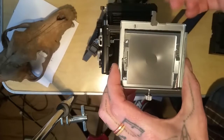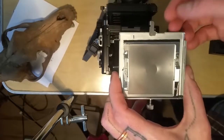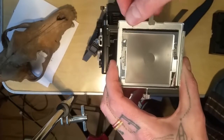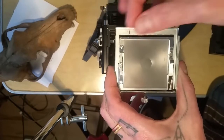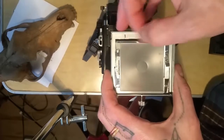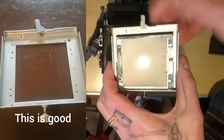When you're removing the old light seals, take an exacto blade — and if you want, a little bit of rubbing alcohol; I use 91% but I think anything less would work fine — and just very gently scrape away the old glue and any of the old material. Q-tips come in handy in this process because you can wipe away as you go, and a little paper towel to wipe off the exacto blade.